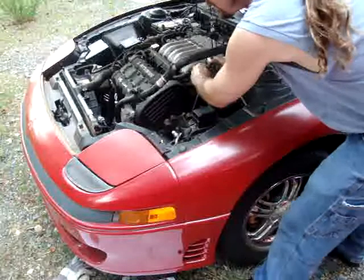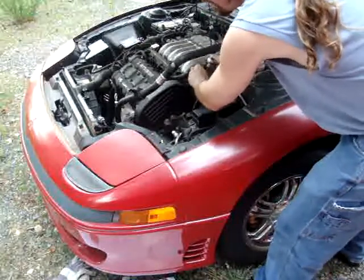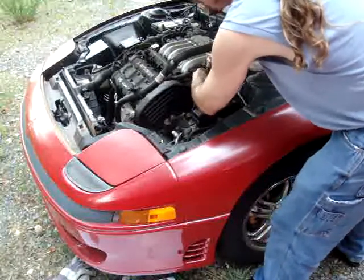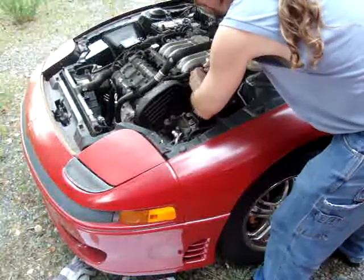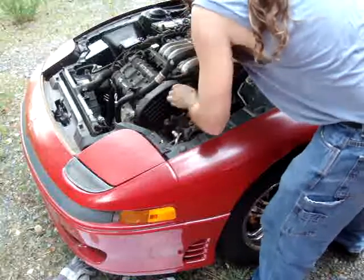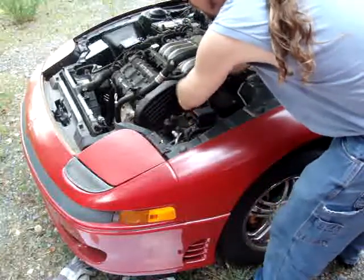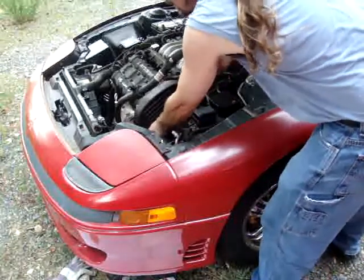After you've loosened the fixing nut, this is the adjusting nut, which is going to release tension on the belt itself. That's one of the first things you want to do before you go messing with the bolts on the bracket, because you need to free that tension. If you start loosening any of the bolts in the bracket first, it's not good because then it's going to be putting torque on them in the wrong sense.